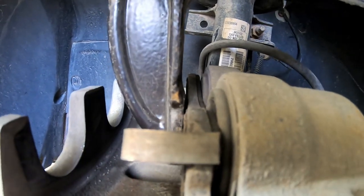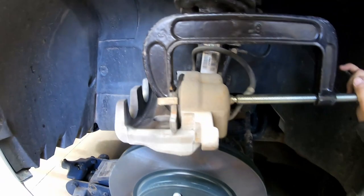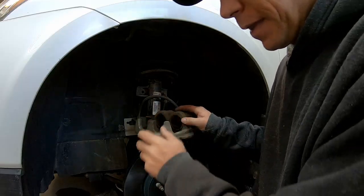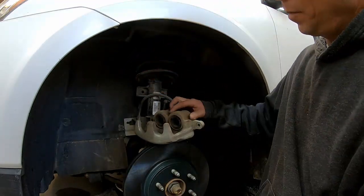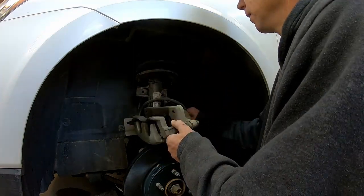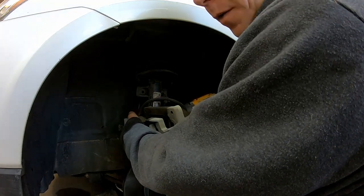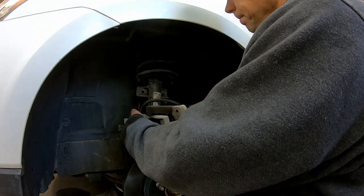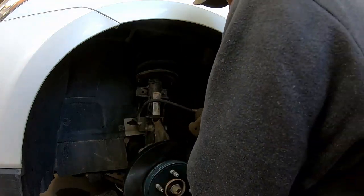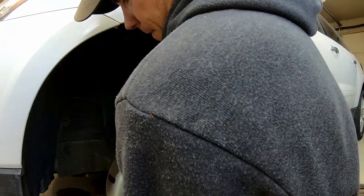If you had opened that up on the back side and bled it off — which is a really easy way to do it too — there's a potential chance of air getting in the lines. This way, there's no air at all getting in the line. I don't have to crank it super tight, just until it goes back. Now that will allow these brake pads to open all the way up. Don't breathe brake dust — it's really bad for you. Now these brake pads are opened up further and they will slide right over the top of this new rotor. Easy peasy.